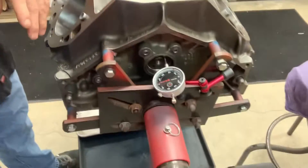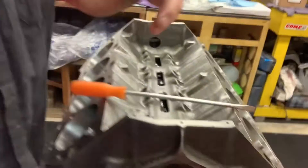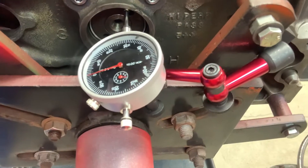How do you check your clearance? Here we go. We have a dial indicator at the back with the freeze plug before we install it, so if you're assembling the engine this is a perfect way to do it. Put it up front, then go ahead and take your screwdriver — be careful with the camshaft, don't get medieval with it — and check your clearance.